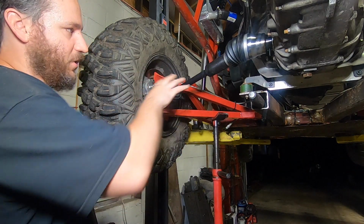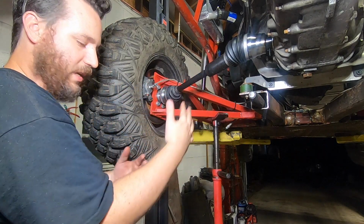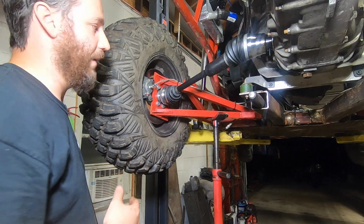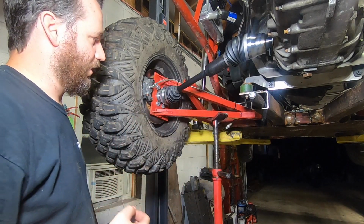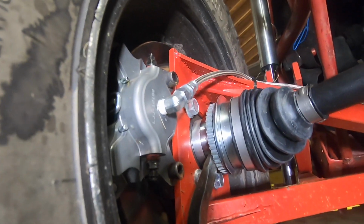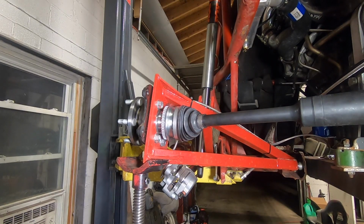But when we have a half inch of plunge, in your worst case scenario, you're gonna lose a lot of your extension as you drop down. So we're probably gonna have to install limiting straps to catch a little bit of our droop so we're not overextending the axle, and that will break the cages in just the same manner. That's just not enough.